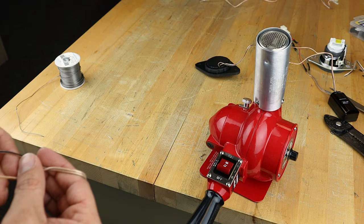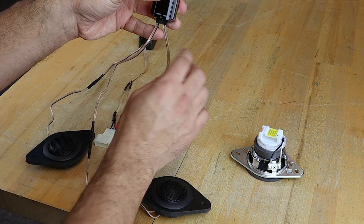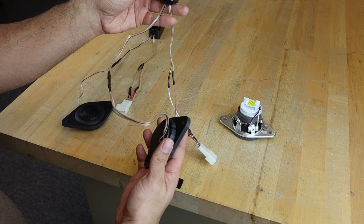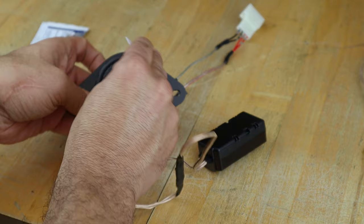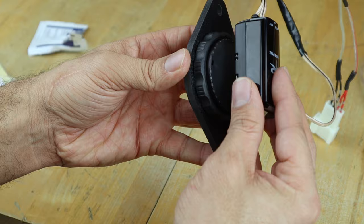So here's what we're left with. This is the factory tweeter, and this is essentially the same except that this is an external crossover not built into it, and this is going to allow us to set our tweeter volume to our preference. The input is soldered to the tweeter adapter made for my car, and the tweeter cables are cut to length — that's entirely up to you. Because there's plenty of room under the tweeter I'm going to use that 3M tape that came with the speakers to secure the crossover to the underside of the tweeter. Clean the surfaces with alcohol, use a strip of tape to secure the crossover. You may have a better idea for placement but in this car this works just fine.